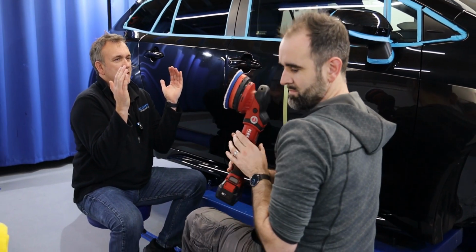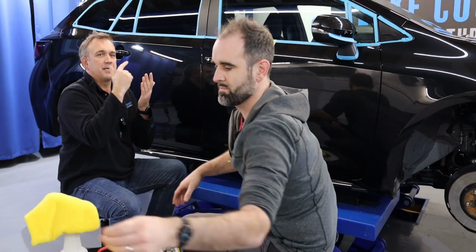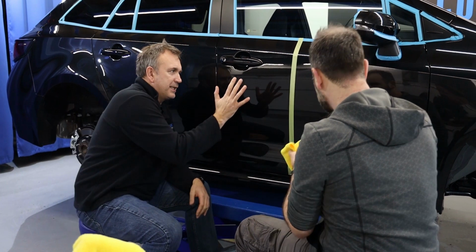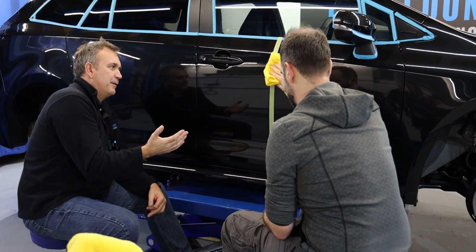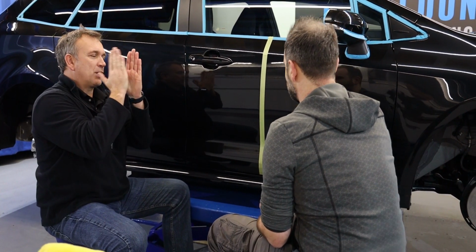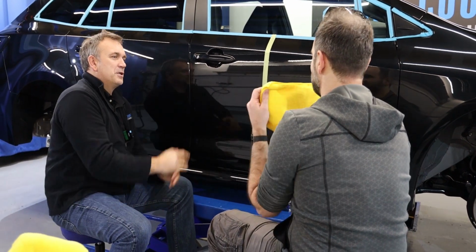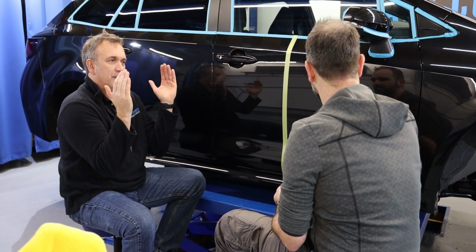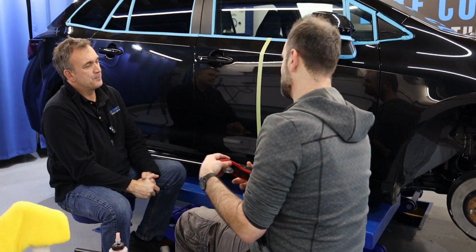Two squares, make them exactly the same, one with a foam pad, one with microfibre, and put the same amount of compound, same speed, same pressure, and go for the same amount of time, then you would have taken a lot more clear coat off with the microfibre compared to a one-step foam. Yeah. But what you've done there, quicker with the microfibre, is only about how long you're abrading the surface. If you keep doing it, it's going to keep on going. Yes, definitely. So it's almost a recalibration of how quick the set would be when using a larger throw orbit machine and a microfibre pad.